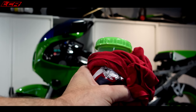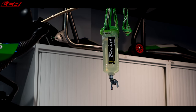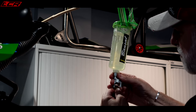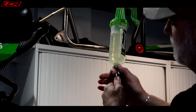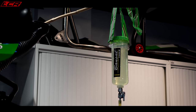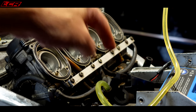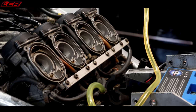Put fuel in it - leaks like a sieve. Hang it up there. I've connected the other end to the fuel going into the fuel pump. Now I don't think the fuel pump is actually going to work - I've heard no sound out of the fuel pump so my feeling is the fuel pump is dead. It's a fuel line connected into the input to the fuel pump and then the fuel pump connected to the carbs. Let's put that into the on position. Let's press the start button and see what happens.